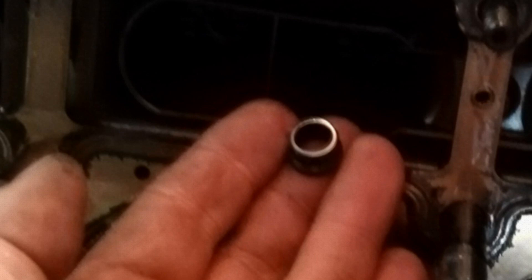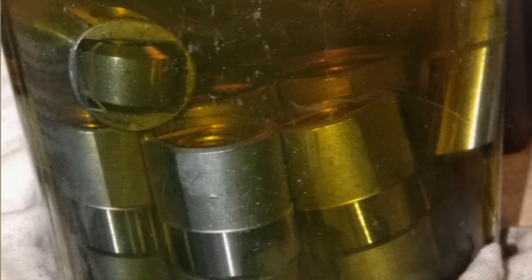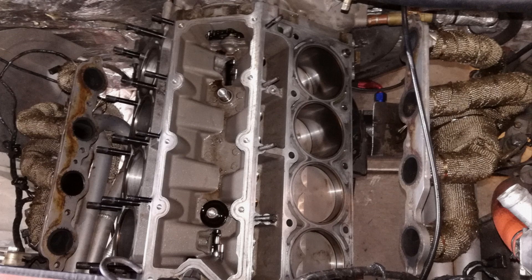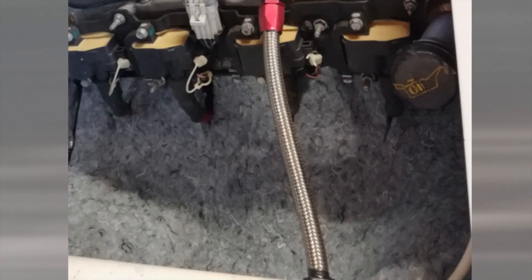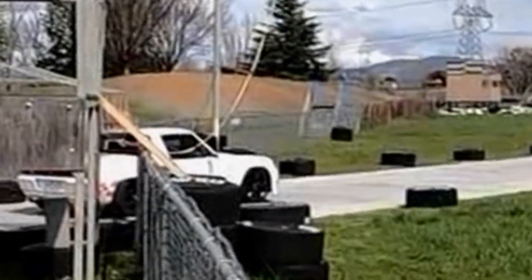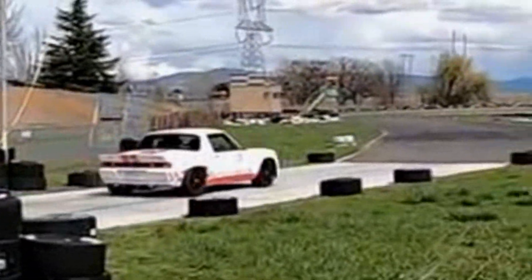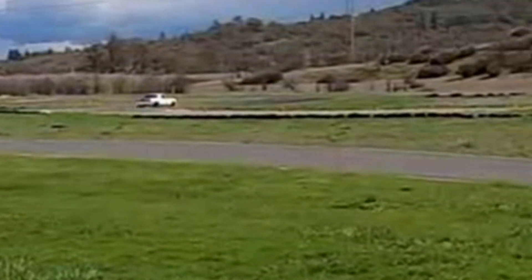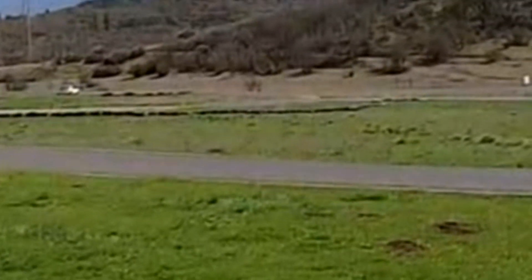With 16 new lifters, the engine sounded better. But according to many long-time LS builders, the aluminum engines are just a bit noisy — adding forged components just adds to that, and adding headers transmits that noise. I'll throw in a quick example video so you can see the difference when I cover the bottom end with a piece of insulation and then pull it off. Overall, I'm happy. Still have some tuning to do, but the engine is in a safe place, makes great power, starts every time, and hauls butt. I made it through every event of the 2019 season without a hiccup — I'd call that a success.